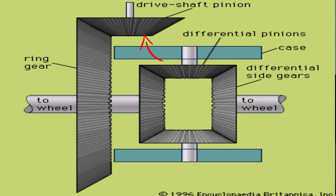So how do differential gears work? Taking this diagram, for example — power is transferred from the engine to the drive shaft, and then power is transferred from the drive shaft to the ring gear. The ring gear contains bearings which support one or two diametrically opposite differential bevel pinions.